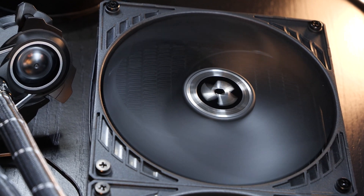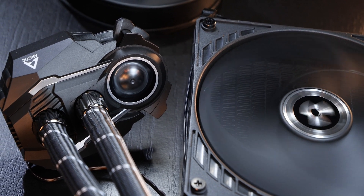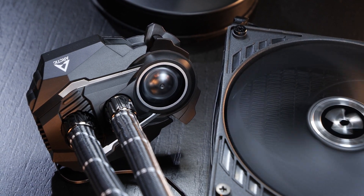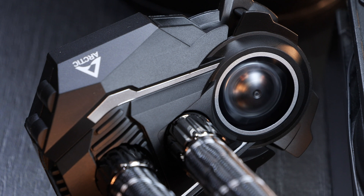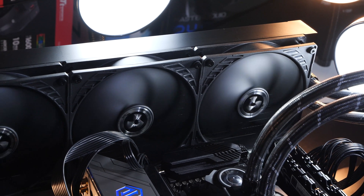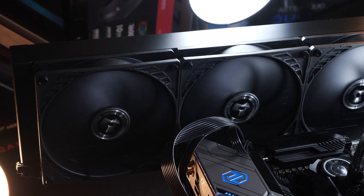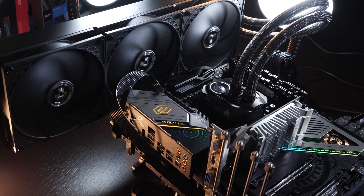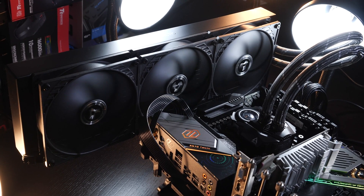Let's talk pump — that one I find interesting. From an aesthetic point of view, definitely not my cup of tea, but tastes differ. What's more impressive on the other hand is the fact that Arctic apparently is relying on their in-house developed pump. A lot of focus has been put onto noise levels, and if you're asking me, they've succeeded 100% in that regard. Same applies to the P14 PWM 140mm fans, which even at their max of 1700 RPM operate fairly quietly while still achieving a pretty respectable airflow. Those of you that have eyes for colors the RGB gods bless us with, I have to let you down — any sort of RGB lighting is non-existent on here. Nada. Red-green-bluers will have to look elsewhere then to satisfy their needs.